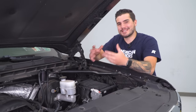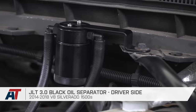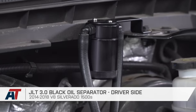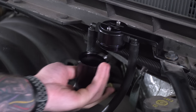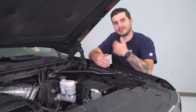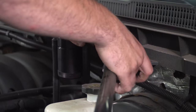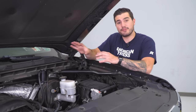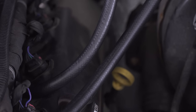This next mod might not be the most exciting or visually impactful, but it's got a ton of function. The JLT V3 oil separator can help prolong the life of your engine by preventing the buildup of oil sludge that could bog down your engine, robbing it of some power and efficiency. Oil separators like this filter out the oil through a canister and separate any oil sludge or blow-by, which is essentially crankcase exhaust gases that make their way back into the engine and could potentially build up over time. The JLT V3 oil separator bolts up pretty subtly under the hood, and the three-ounce oil catch can collects all of the waste. There's a filter on the inside to help with that process, and it basically just replaces a PCV tube from under the breather line there under the hood.